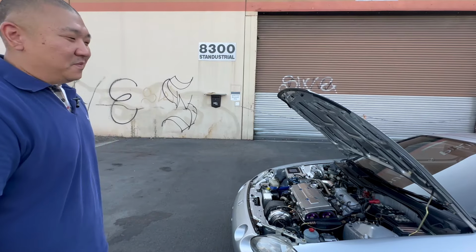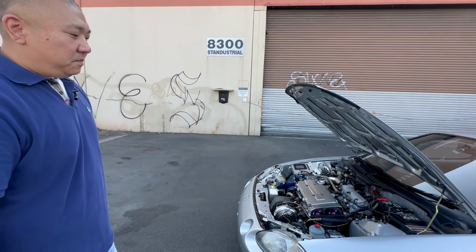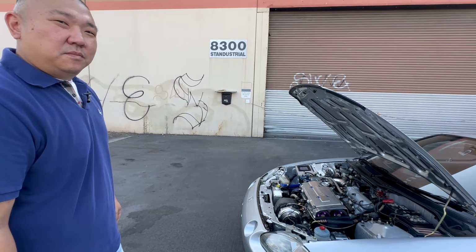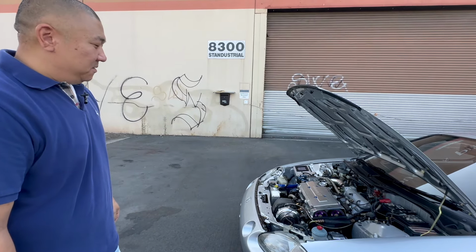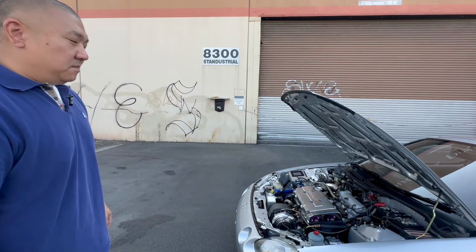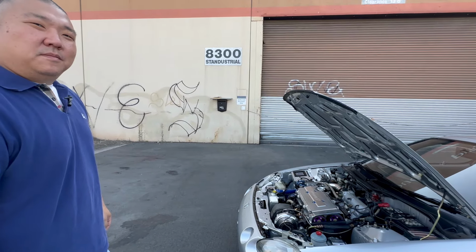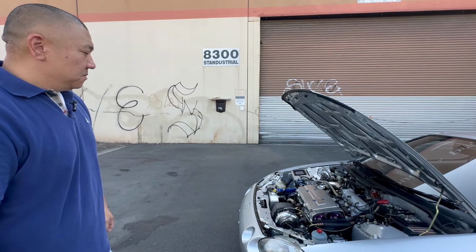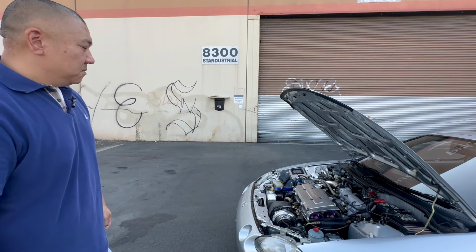I think I sold a turbo timer and a boost controller to some guy back in the day, and he's like, do I need it? I'm like, yeah. I remember I saw some kid with a WRX a while back, and it was sounding horrible. I was like, do you have a turbo timer? He's like, no. Do you have a boost controller? He's like, no. I was like, get it. Get a turbo timer. It'll extend the life of your turbo, and the boost controller will make it easier to control your car.